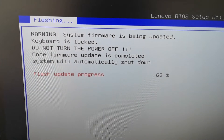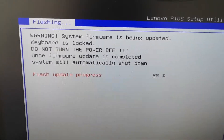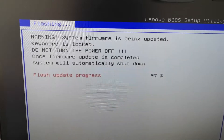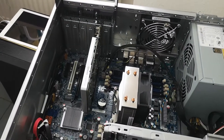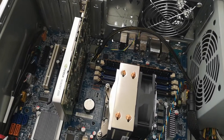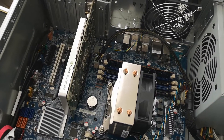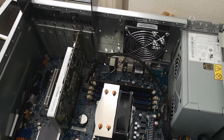Have confidence — this does work. This is actually the third time I've done this today because I broke it again twice. What I did was go back to that CSM setting, and instead of disabling it, I set it to Auto — and that again bricked the machine and caused it to not display anything on power-up. It's powered itself down, so hopefully it has flashed the BIOS and will be ready to start again.